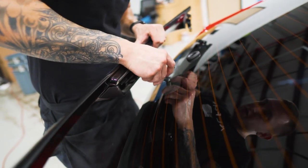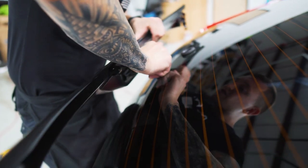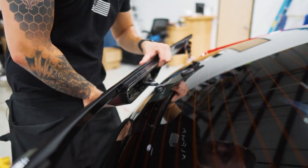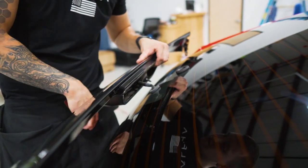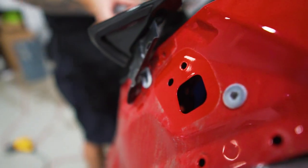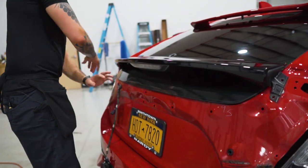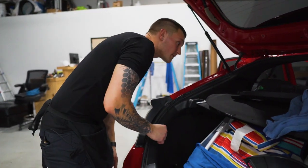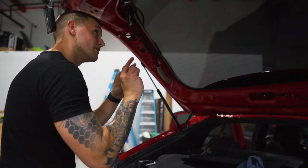To put the grommet back, stick the wire in, get all the rubber in, get one side of the grommet on, and push the side in — it is a little tricky but don't get stressed. Once you get one side in, take the gasket stick and give it a final push. Line up the center hole, then the sides. Make sure the screw head is in the white plastic clip. Once it's in place, give a little pop — done. Open it back up, and put that bolt with the 10mm with the washer back on the wing. Not too tight — if you have an impact gun, you'll break the glass.